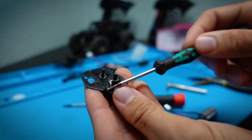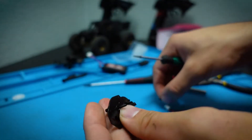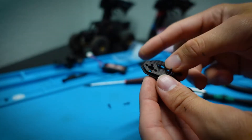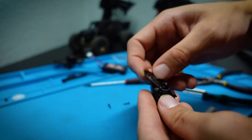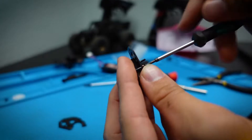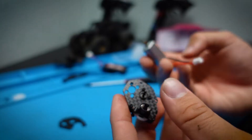If you have it oriented the wrong way it won't really work, so just eyeball it and match up your holes. There are four screws holding the old motor plate to the transmission. This would also be a good time to rebuild the transmission if you were planning to, since you already have it apart. On the stock plate there are two holes versus four on the new carbon fiber plate. Swap it in, line up the holes, and reinstall the screws — no modifications or drilling required, it's all done for you.